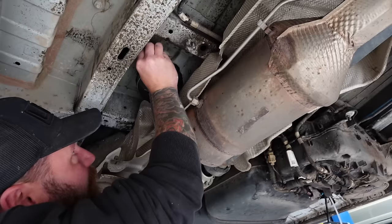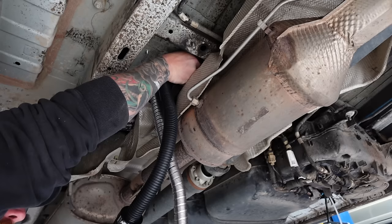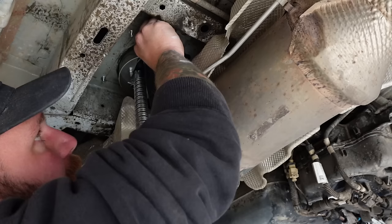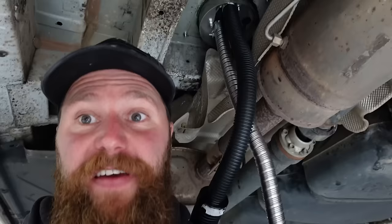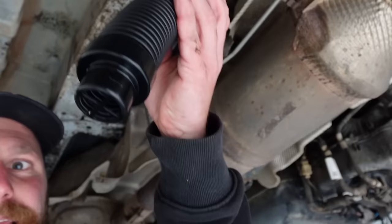This is one of those silly little jobs that is so much easier with two people. We're opting for a stainless steel nut and bolt - you could rivet it, self-tap it, or use a rivnut and bolt. With two of us we can apply pressure. That is our diesel heater fixed to the van, with all of the appropriate tubes coming down, affixing in each corner.